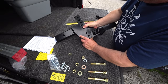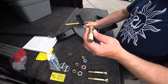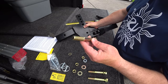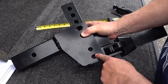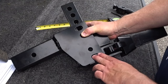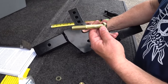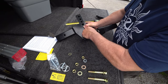Now at this point I need to start putting bolts in these holes. You're going to get the shortest bolt — there are three bolts, one shorter than the rest. That's going to be the pivot bolt. Now, I realize these slots are oblong shaped and you might think the bolt pivots in there — no, that's the pivot adjustment lockdown bolt. This pin is actually what it pivots on. So we're going to go ahead and put it in the pivot hole.